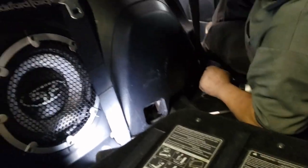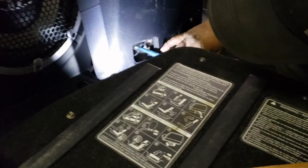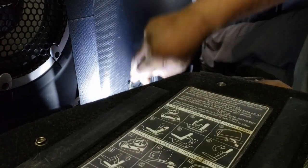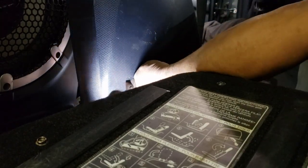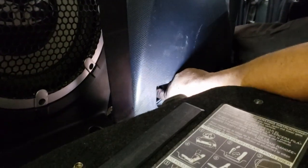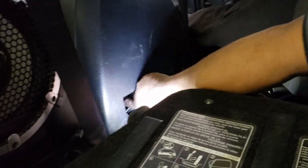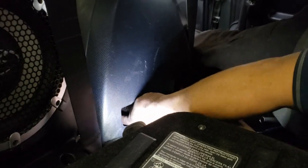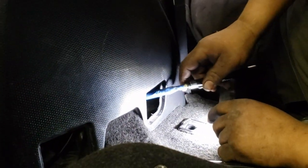Line up the top two studs to the two holes in the subframe very well, and then jack up the control arm. Start the two 14mm nuts by hand first. Use a magnet where possible so you won't drop the nut in that small compartment.